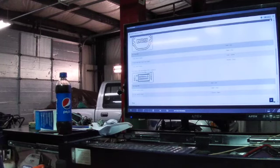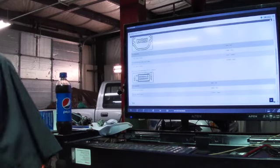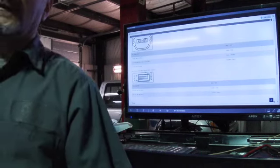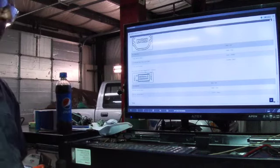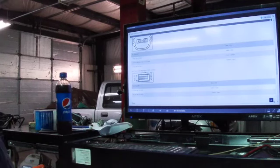If I don't see it, I'm going to grab a capture of in-cylinder, and a capture of the control of the solenoid at the same time while it's under load. When I tested it before, like I said, I did it with no oil pressure load, no load at all, just to see the solenoid, and it looked good.